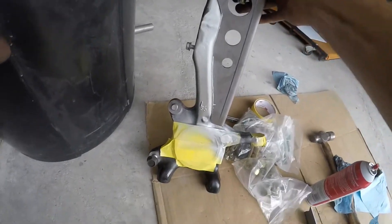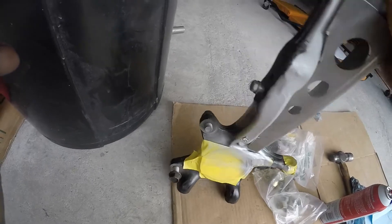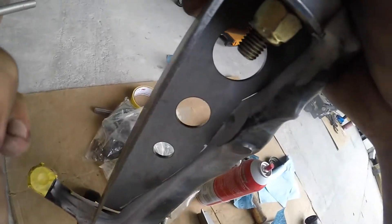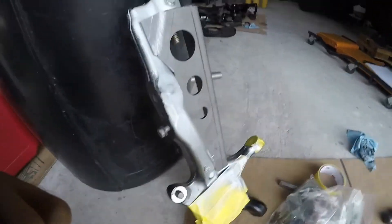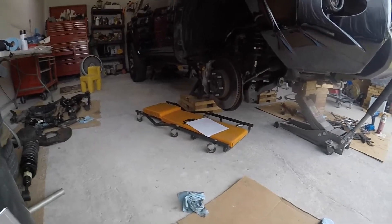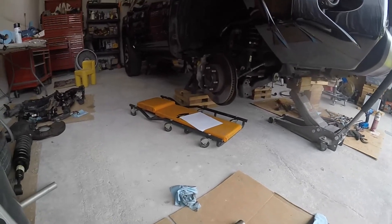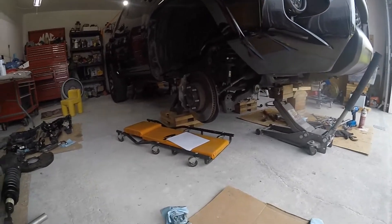Just as I thought I was ready to go, I got everything coated and set in place to tack. I kept thinking about how I'm going to make this work with my sway bar connection. This hole here would be my sway bar end link, and on the back side it is impeded by this gusset. I realized I don't have the right spindle gussets to utilize the sway bar — I'm going to put a traditional sway bar, the 2-inch long travel Total Chaos extended sway bar, which utilizes factory end links on the vehicle.